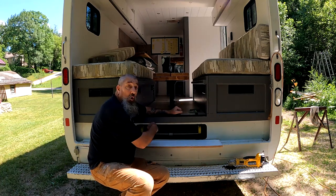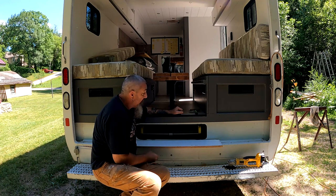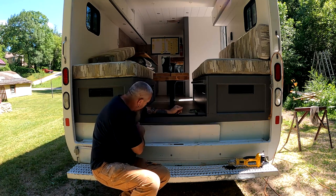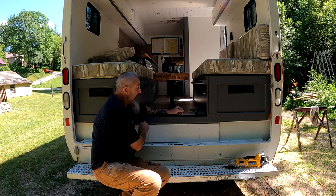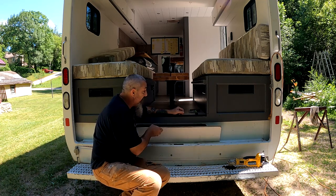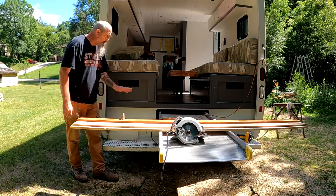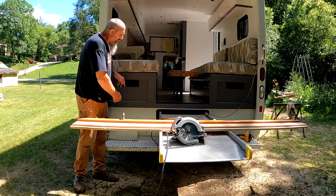One of the things I've got to do is close off the hole because airflow comes into the van through it, and I don't want unwanted air — especially traveling down the road, because that's going to kick up a lot of dust. So what I'm going to do is install a door on a hinge, similar to the one I currently have installed, so I can unlatch it, lower it down and have access to pull the ramp out as needed. Otherwise it'll be a sealed system. I've got to rip this one-by down — there's a little bit of a taper from one side to the other, about a quarter inch — and then rip it down to the correct height and go from there.